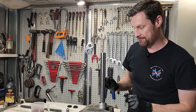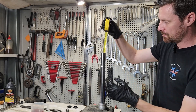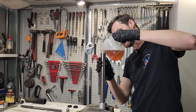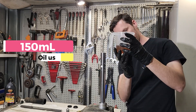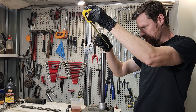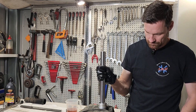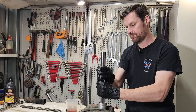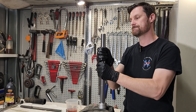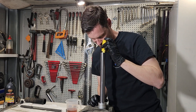We're going to go 8 inches from the top to where the oil starts, with the chrome rod all the way down. I've been advised to put in 150 milliliters of oil — that's a good place to start — and it was bang on 8 inches, though it was just putting oil on the end of the tape measure. Once you're happy with that level, just stroke it up and down, releasing any air — five or six strokes, nice and slowly, all the way to the bottom and all the way to the top. Return it to the very bottom and re-measure to make sure it's still 8 inches. After pumping, 150 milliliters consumed and we're still right at that 8-inch mark.